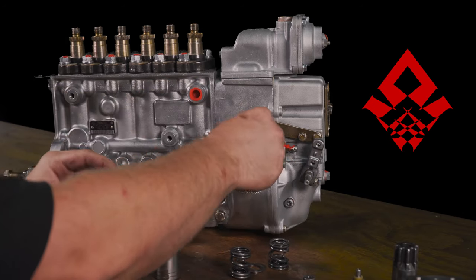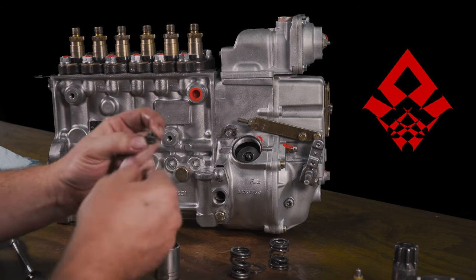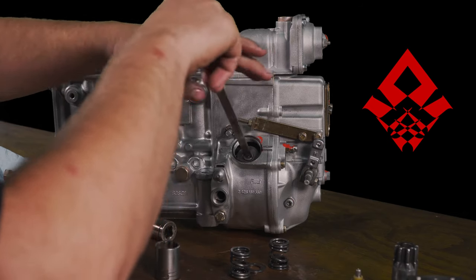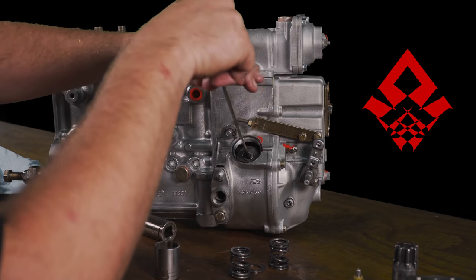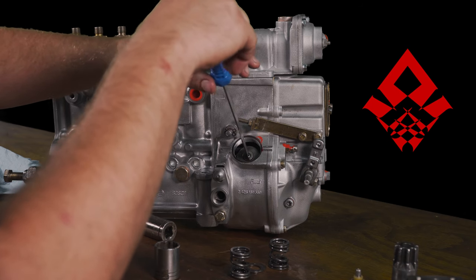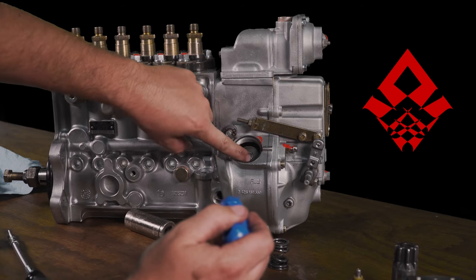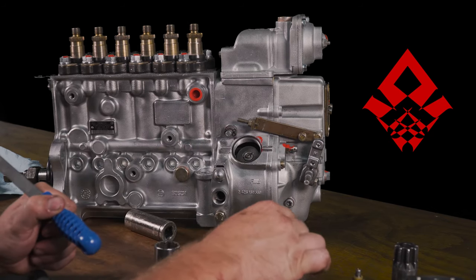This factory retainer goes back on top, and this nut goes in. There are four cam bumps on this retainer — that's why it clicks when it starts getting tight. Go over tight at first to make sure everything's seated. So we're going in: initial, first click, two clicks. You can also measure protrusion — about 50 to 60 thousandths protrusion. If you want it to idle very close to stock, set this protrusion the same as you had before. If you go too tight, your idle will raise a little bit; too little tension and your idle will drop a little bit.